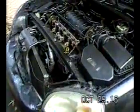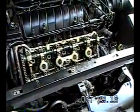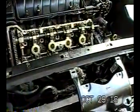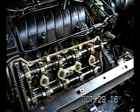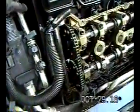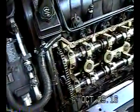Okay, I just wanted to show you. I took out the cooling fans and the radiator. That gives you a whole lot more room to work in the front. And I have to confess, at this point, I've replaced the valve covers, gaskets and so on, but I've never actually done a head gasket job. I should disclose that right now. So I'm just working from the manual, and this is where my expertise ends, and my reliance upon the manual begins. So I know we're going to have to remove the alternator, which is down there, because that's bolted to the head. We're going to have to remove these. Some stuff here, I'm going to have to figure out what exactly. I don't know if the power steering pump has to come out or what, but I know we're going to have to remove a lot of the pulleys and shit here in order to access the timing chain cover, the engine cover, and the timing chains.